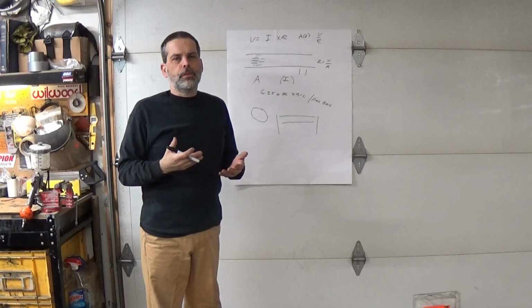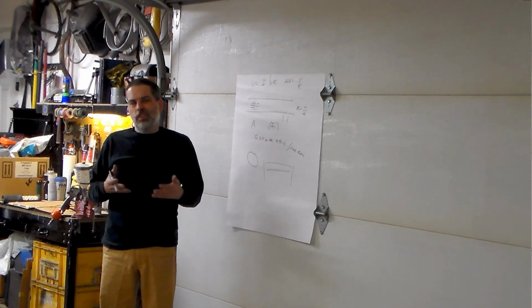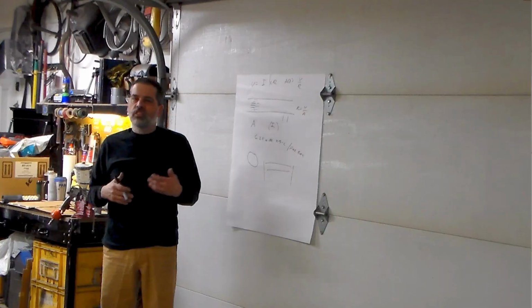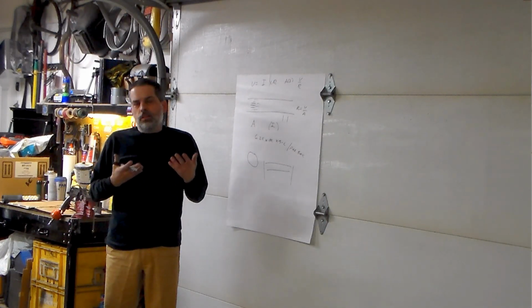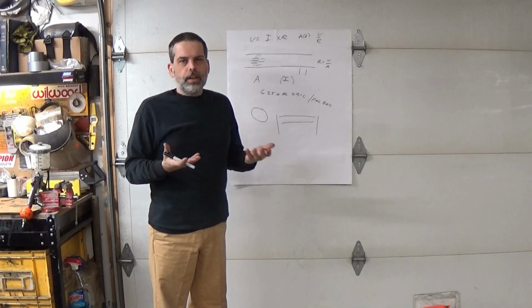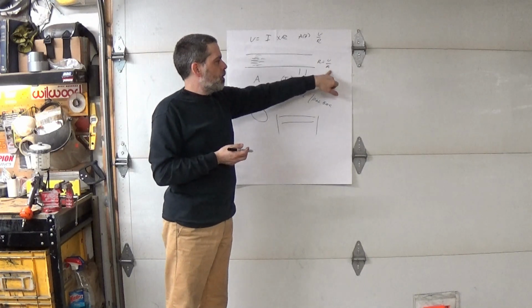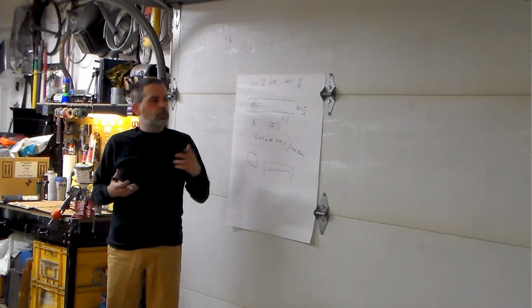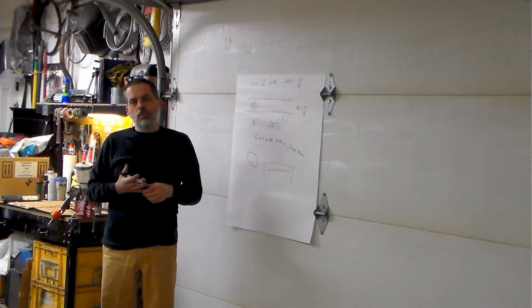Think about if you have a bulb that's kind of dim in your car, and typically then there's a problem with the circuit somewhere. There's a small break in the wire, still allowing a little current to go through, or the resistance is somewhere affected. And typically like that, it's like a dirty ground. So if you apply the formula of Ohm's law, you think about the increase in resistance in that circuit, it's going to decrease the available amperage that's going to go into that bulb.